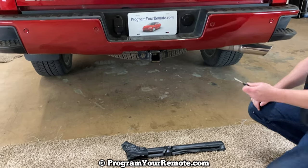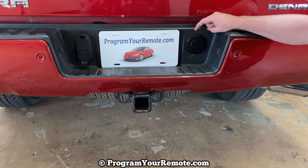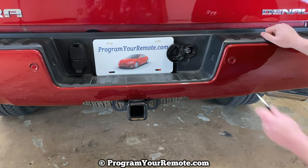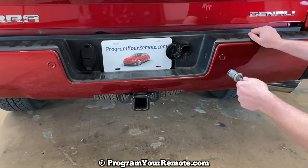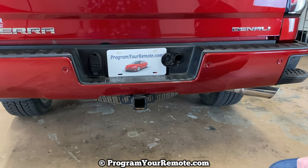The first thing we need to do is take our ignition key. Just to the right of the license plate, you're going to see this little piece — flip it open and there's a key cylinder in there. Put your key in there, turn it to the right about a quarter of a turn, then pull that straight out. It can take a good amount of pressure to get that out. Once you get it out, just set it to the side.